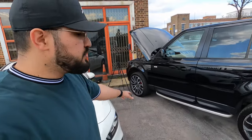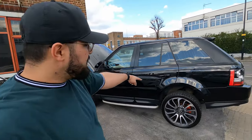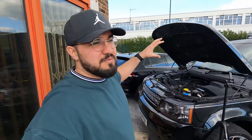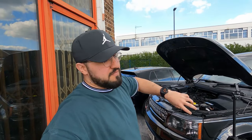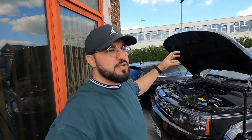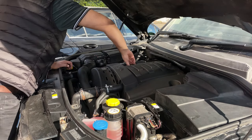When you buy this sort of car, before you test drive it or check the bodywork, make sure you start the engine and put the car in the highest suspension setting and have a look underneath the engine bay. The first thing you want to look for is an oil leak. Range Rover Sports suffer from a lot of oil leak problems, and fixing an oil leak on this sort of car is not an easy job — sometimes it requires taking the engine out of the car.